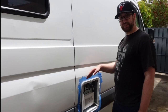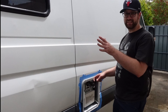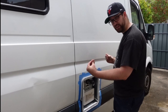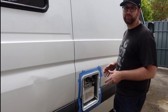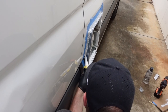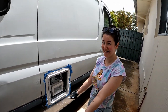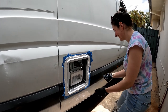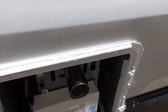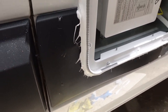I've just pre-drilled all of these. Now we're going to apply Sikaflex all the way around — we're going to have to build it up a lot on the sides because there are big gaps there. Unfortunately these don't contour to the van as well as the gas boxes do, so we'll Sikaflex it then screw them in. There's going to be wood on the back to pull it all together and hold it tight, which is great — we don't have to shove a bulk amount of wood in here to try and make it set. Luckily we put all the edging tape around because the Sikaflex goes everywhere. Hopefully we get it nice and neat and peel the tape off before it starts drying so we get a nice little edge.